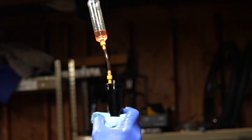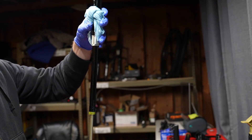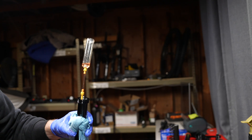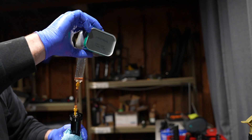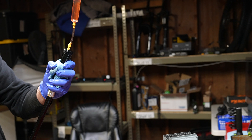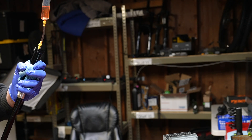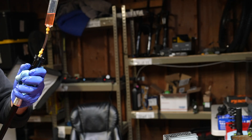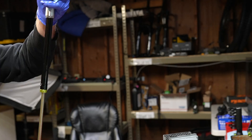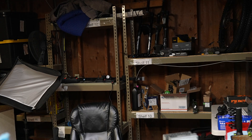Fill the bleed tool up with oil. Pull the rebound rod down and make sure the bleed funnel on top does not suck any air in — add a bunch of oil to it. Stroke the rebound rod super, super slowly and make sure nothing gets sucked down — this took quite a while to get all the bubbles out. Move super slow to not introduce bubbles. To close the bleed screw: pull the rebound rod all the way down, push it 10mm up from the very bottom, then put the bleed screw back in while it's overflowing. Double check your bleeding by holding it to your ear and rapidly cycling it — you can hear if there's air in it. My first time there was a little air left and I had to redo it.